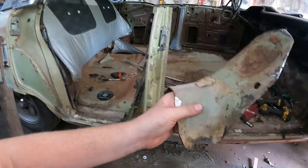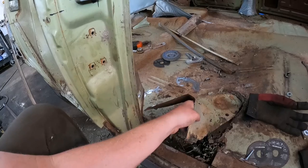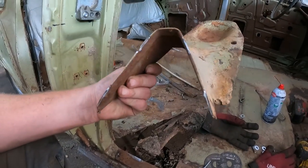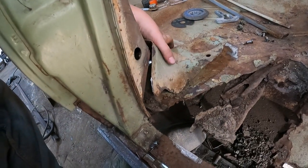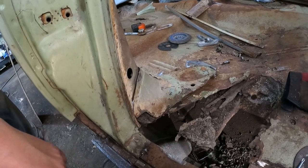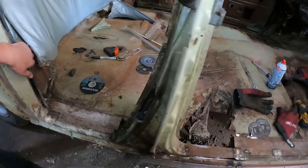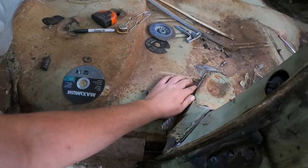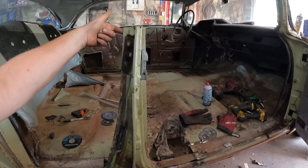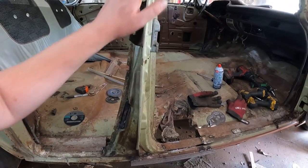What we're working on next is this little kind of brace piece which would have been in that big hole. Obviously these things rot out, and that's what causes the post to really go. It also only has a couple of ugly tack welds on it, so all the material's gonna come out. This came up real easy — just had a few little welds on it. So what I'm gonna do is just kind of put it back on temporarily. You can see it's meant to fit a different contour, so this will obviously have to be modified when it goes in permanently. On the back side it's flat enough that I can get some good welds on it, and I'll weld it back to the post.